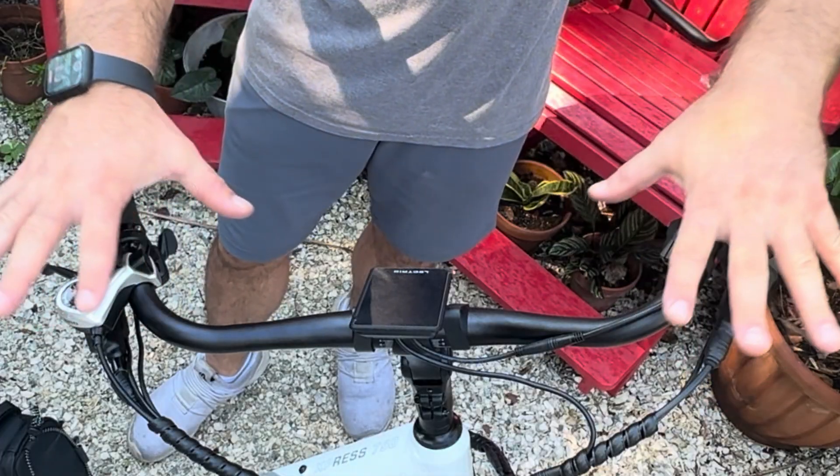We're all in on that. Now I'm going to bring this around, undo this wrap, and unplug this horizontal throttle. You can see they have the same style three-pin connector. This cable is a little bit longer because it's meant for a variety of electric bikes. Remember, line up your arrowheads and point them at one another to connect. What I do is take a loop and bring it back on itself, then put that within the wrap when I put the wrap back on the bike. Let's get over to the left-hand side.